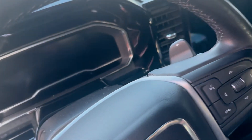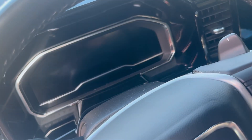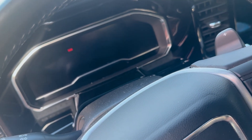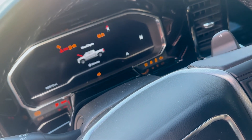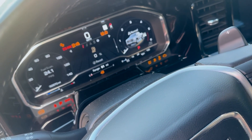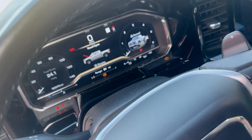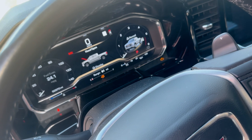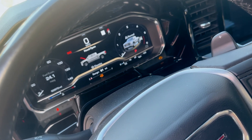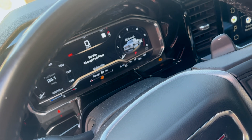So that's it — pretty simple. Now what we're going to do is turn the key on. It's a keyless ignition, so hold it down without the brake. That turns on the fuel pump, and we're going to let that cycle — we can hear it pumping. GM says to do this for two minutes. What that does is prime the system and get any air out. There shouldn't be any drivability issues with that.